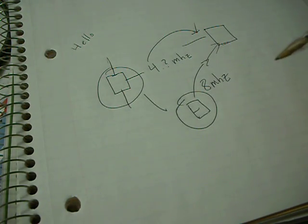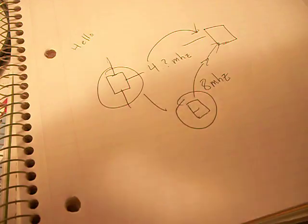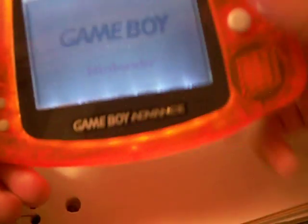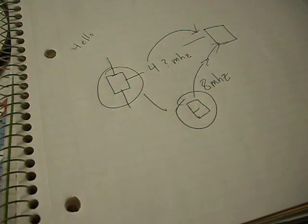So every second it just sends out a tick, basically, and that tick goes to the brain, which every time it gets a signal, it does a computation. So when you overclock it, what you do is you replace this with a faster chip. The one I put in here is 8 megahertz. So every second, 8 million pulses go to the processor, which is responsible for a faster game. I could demonstrate that a little bit.